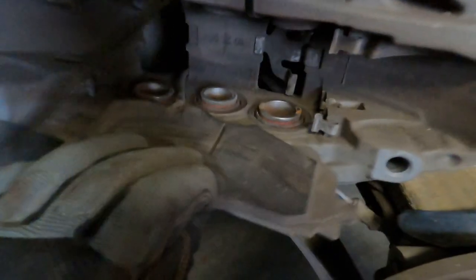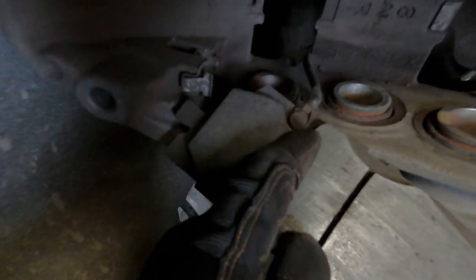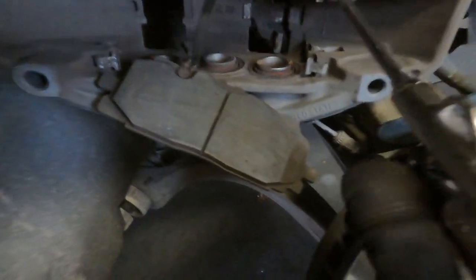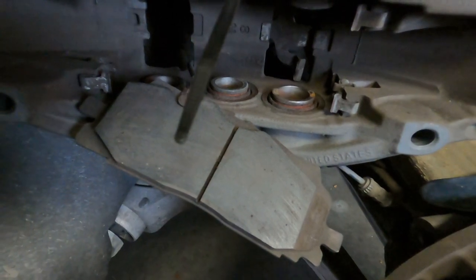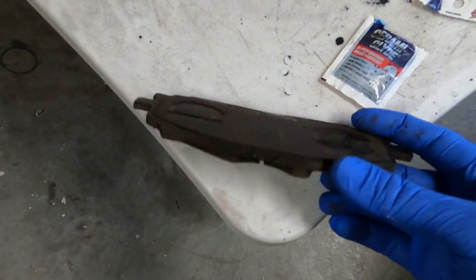Not as easy as I make it look. There is where that wire is tied, which is probably an actual brake wear sensor to tell me when the brake pads need replacing — that's why it's indented right there. We're just going to leave that hanging where it is. I'm going to blow this brake dust off with our compressor — wear your masks, people — and then we'll put some brake quiet on the backside of these shoes.